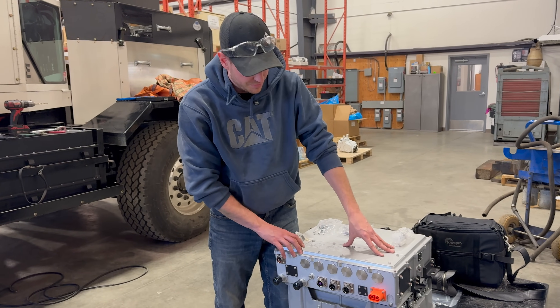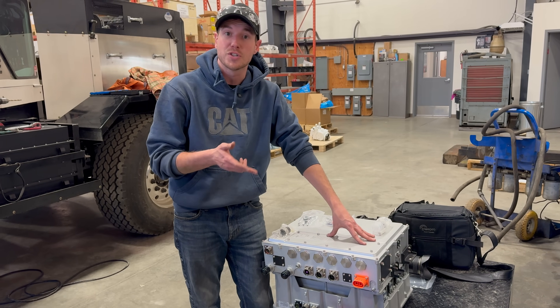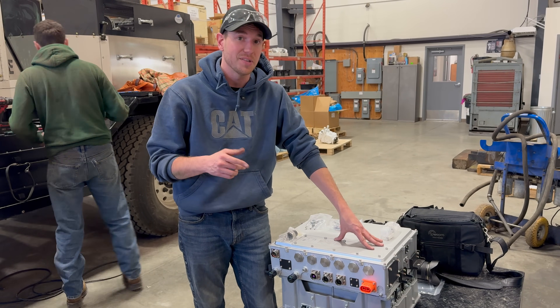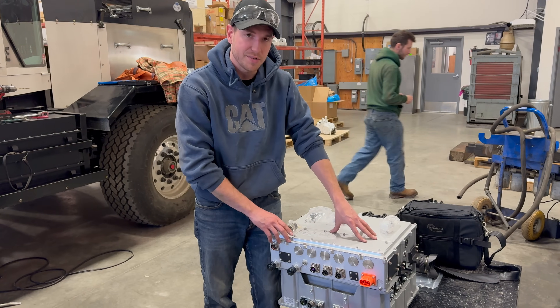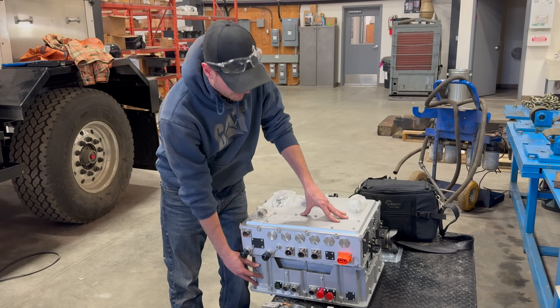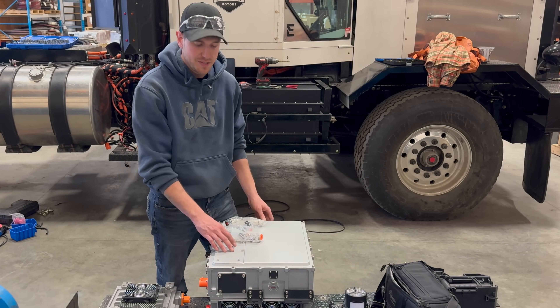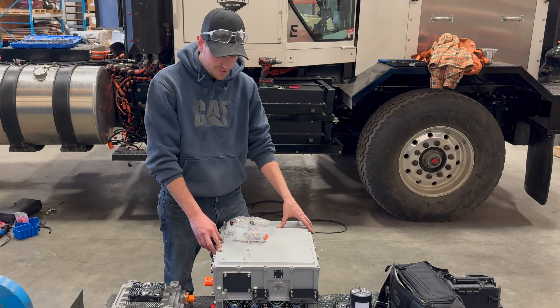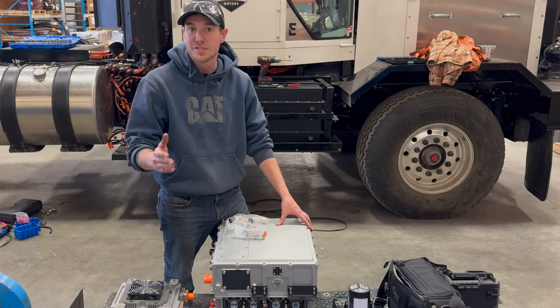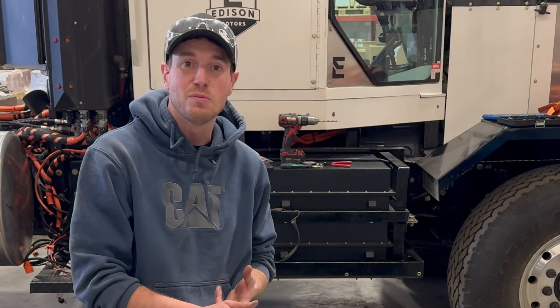What you're seeing here is a 3-in-1 inverter. It does the power steering pump and air compressor, and this one will be able to charge our 24-volt and 12-volt batteries at 3 kilowatts instead of 1 kilowatt. More importantly, the reason we're putting this in is the generator right now can only produce about 590 volts because the old unit was rated for that maximum. This one is rated for 750 volts, meaning we can actually get to 1800–2000 RPM on the generator. This is also the standard inverter going forward on all our semi-trucks, rated at 700 volts like our new battery systems. That means on Topsy we can now upgrade the software and firmware to match, so it's actually a good thing we're doing this.